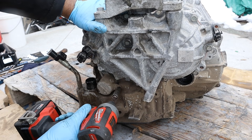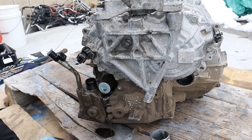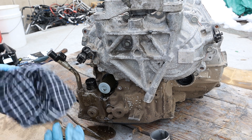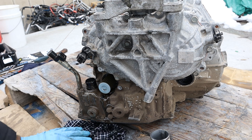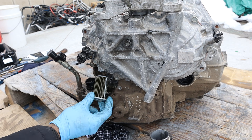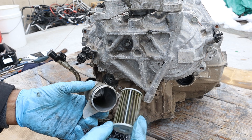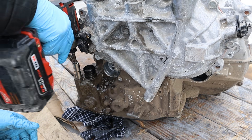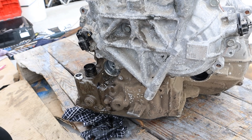Starting over here on the side of the transmission, we've got this 10mm bolt for the filter. I can remove the filter housing — a bunch of oil comes gushing out. I pull out the filter here; it's kind of like a cartridge style oil filter. I like that it's pretty easy to access, and of course only having 2,000 kilometers on it, it is pretty clean. I'll also pull off this 10mm for the dipstick.